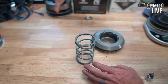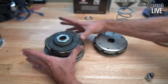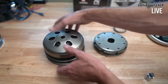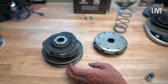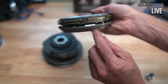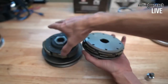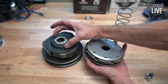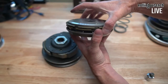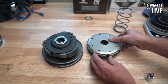If you don't know about a Ravino clutch, let me explain. With a standard clutch, as it spins, centrifugal force kicks these pads outward — the bell is spinning too, and once the pads grab, the pulley starts turning. That's the standard clutch. Now with the Ravino, similar to how a variator works, there are rollers on a ramp. As it spins, the rollers roll out — but instead of spring pressure deciding engagement, it's weight, just like a variator. When the rollers roll up the ramp they squeeze the pads down and lock them in place. This is essentially how a motorcycle clutch works, adapted to a scooter.